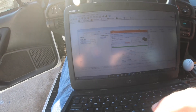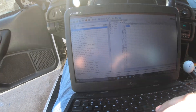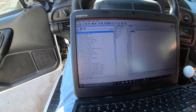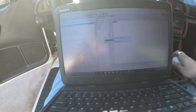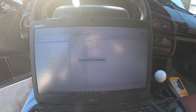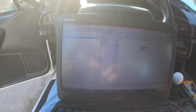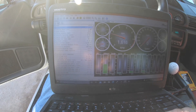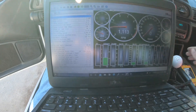It just finished, so I'm gonna go ahead and open up the scanner. I'll put my two-bar layout on so it knows it's two-bar, and I have a two-bar channel config too. We're gonna connect to it — opening the interface, gathering information, all that jazz. I moved the seat up a little bit so I can reach the clutch pedal. It's working — idle's a little high right now, but you can see injector duty cycle and all that stuff. Now we're running on a two-bar MAP.